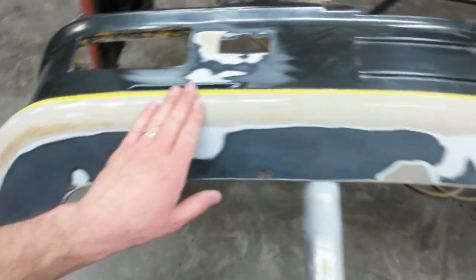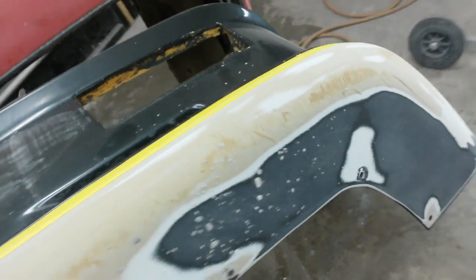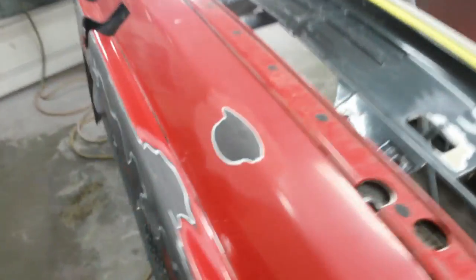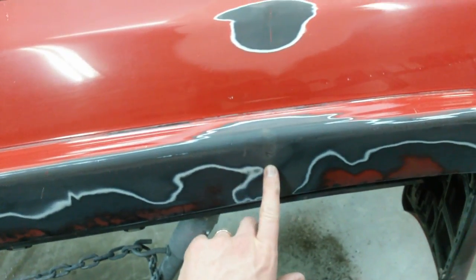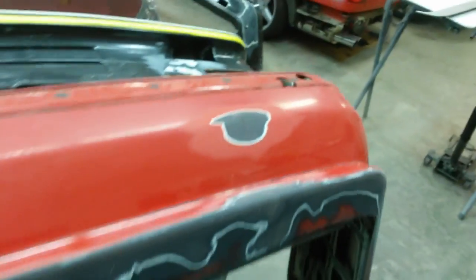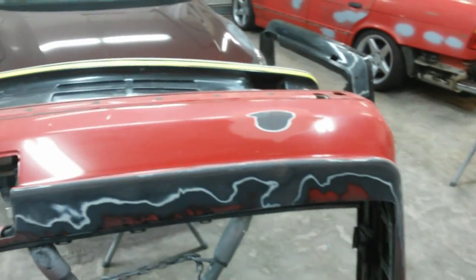Here's the front one. I've got the bottom sanded down all the way through — the scratches that are in the plastic I'll have to put filler in. That kind of flattened it out so I'm going to have to build that up a little bit and curve it back. I heated this portion up here and flattened it back out. I'll have to put a little bit of filler right in there where it was impacted; the rest of it is straight. I'm going to be doing the rear bumper for the BMW M5 with this too — it just needs a little work along a couple places in the back. There's a pretty deep spot here and here that looks like it all happened at once and wrapped around into this area. I'm going to spray adhesion promoter and get some plastic surface filler for the 3M 5887 and put it in these areas, then prime them.